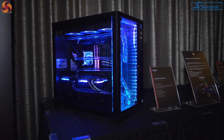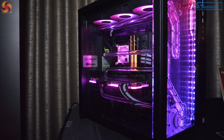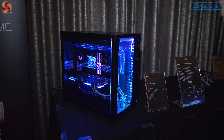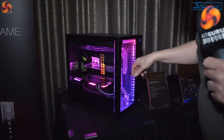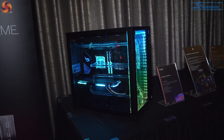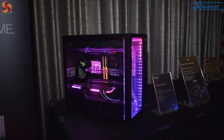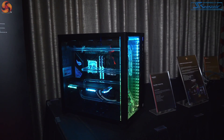So it's a proper system. You'll see a Lian Li Derbauer O11 case. Apparently Micro Center has actually spec'd this system themselves — they selected the case, they've got the components, and they've got EKWB to connect all the bits and pieces up. Now we've got a distribution plate at the front — it's going to change very slightly such that you don't have to have quite such dramatic tube bends. They've got some fittings, so they'll be able to do this build with straight runs of tube, which is a very nifty thing indeed.